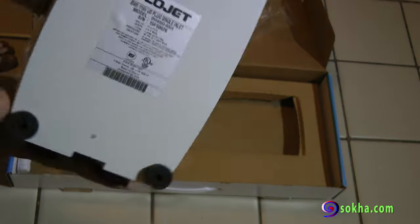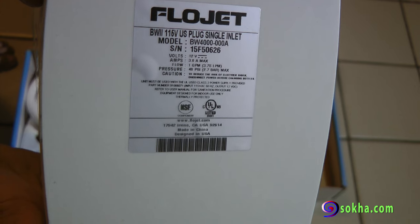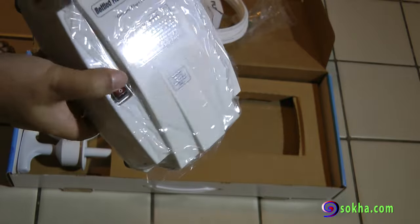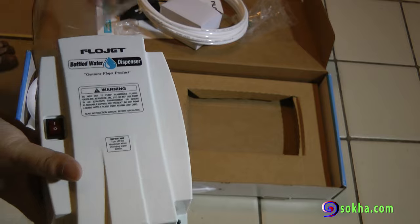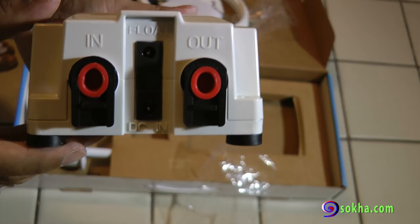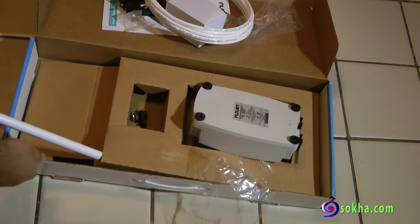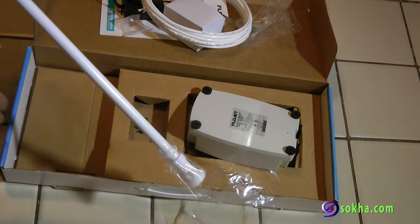There's an in, there's an out, a water input, and here are the full specs. My fridge requires at least 30 psi for the ice maker to work, and this pump creates 40 psi, so it's enough to meet the requirement. The pump came with a manual, and the pump itself is nicely labeled — you can see the in, out, float, and power input, so you just hook up accordingly.